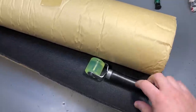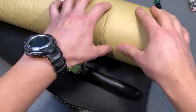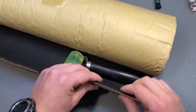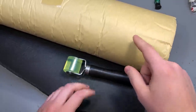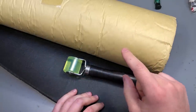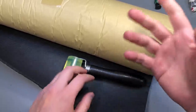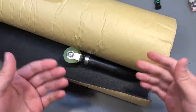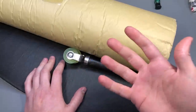The last two items are a roll of soundproofing foam and a pressure roller for installing the foam pads. The foam roll is 200 by 50 centimeters and 5 millimeters thick with adhesive backing. I plan to install this in the trunk of my car to lower road noise coming through those panels, since the boot area seems to get the least insulation from the factory. I don't expect a dramatic change since this is cheap foam from AliExpress, but I'm hoping for a noticeable difference.